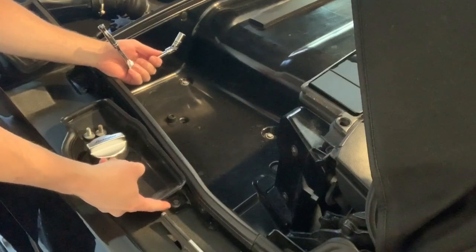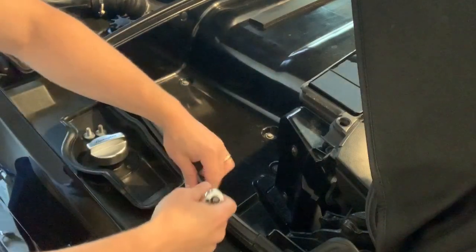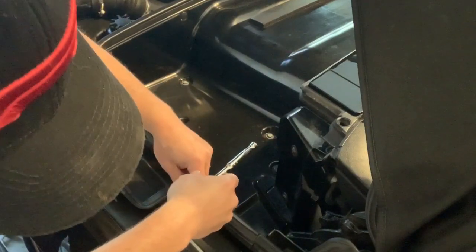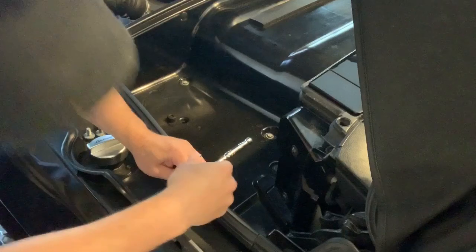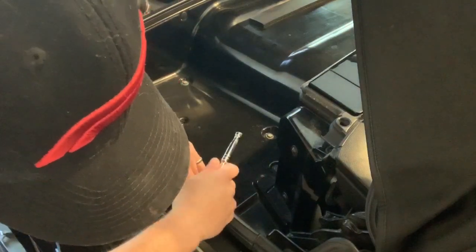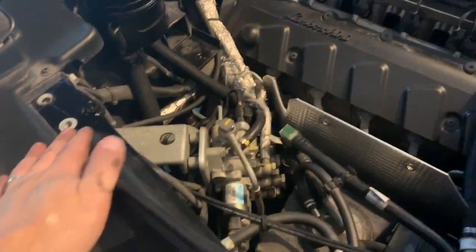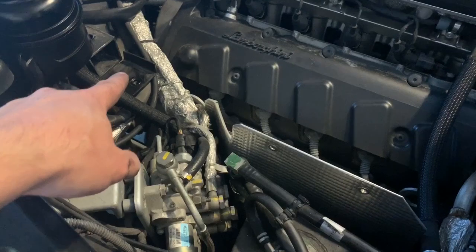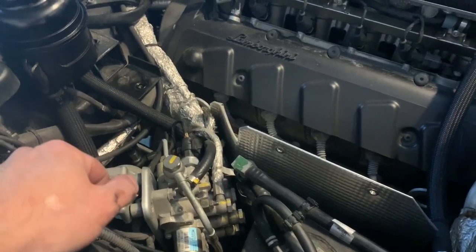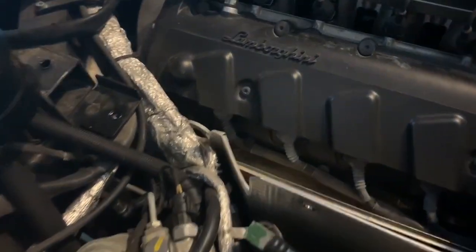You can see where I'm pointing. It's kind of underneath the plastic trim for the fuel filler neck, but if you use a socket with a swivel — I'm using a small ratchet with a skinny extension — you can fit it right on and get it off. I took the engine cover off; definitely helps to have two people. It's kind of a pain but it opens up a whole lot. I also just removed this frame member — there are five 13 millimeter hex bolts on that and it comes right out. There's no load on it so that frees up a lot of space.